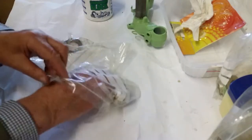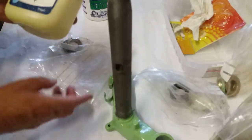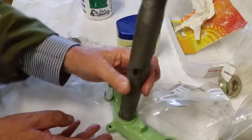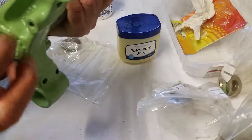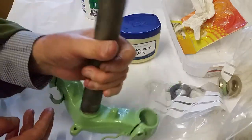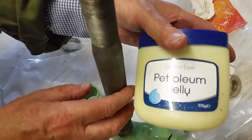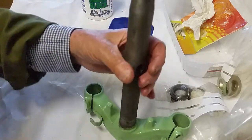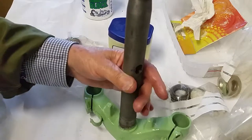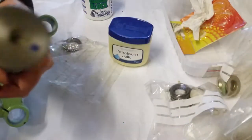My plan is also to put some Vaseline onto this big chunk of metal when I assemble it. There's no strict need, it's steel, but I found it was really rusty when it came apart. I had this section shot blasted and the stem taped up, then painted it. I think I need a bit more paint and lacquer. The Vaseline keeps things waterproof, so I'm going to apply some down the stem to make sure there's no rust after reassembly.